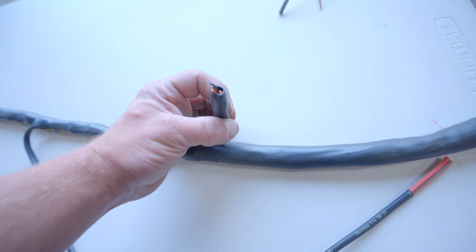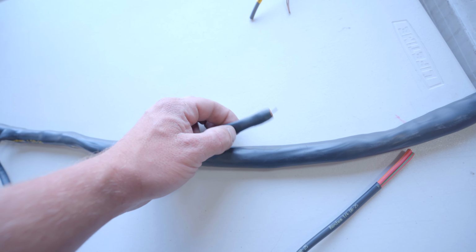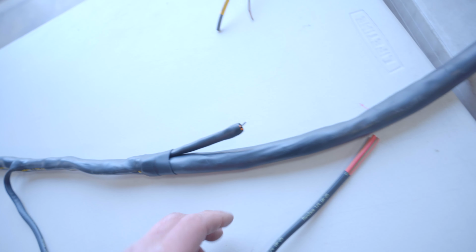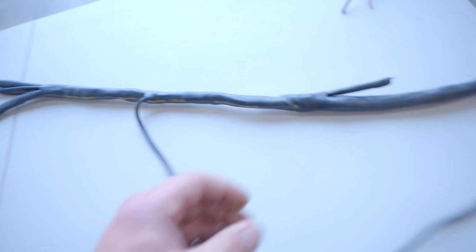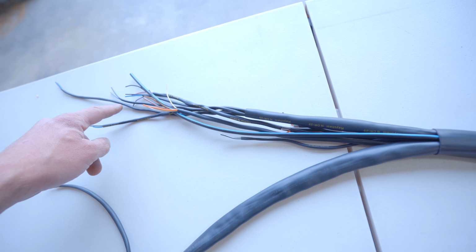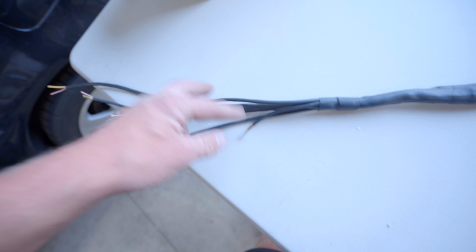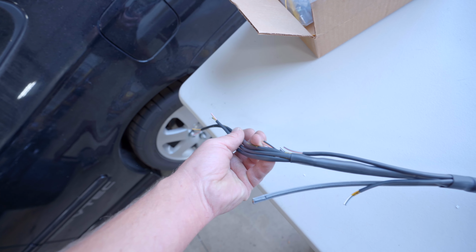This is a spare little harness for extra wiring in the bay. If we ever need a 5-volt, 12-volt, a ground, any signals, they're all in there. That goes to the fans. This is everything underneath the intake manifold, including injectors, vehicle speed sensor, both cam sensors, coolant temp, and all of the coil packs. The entire harness is fully loomed.